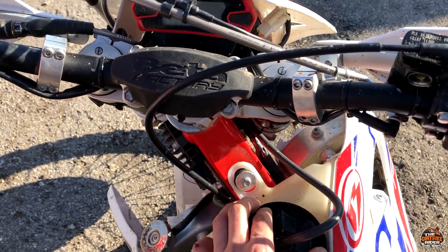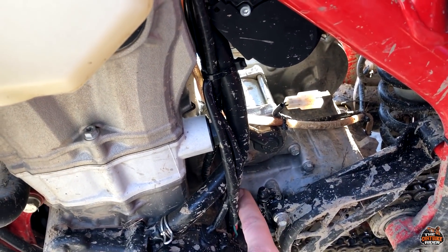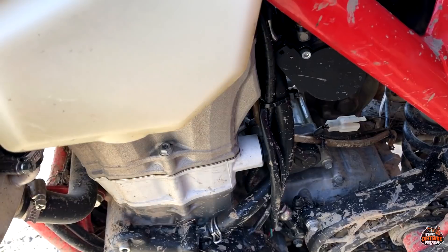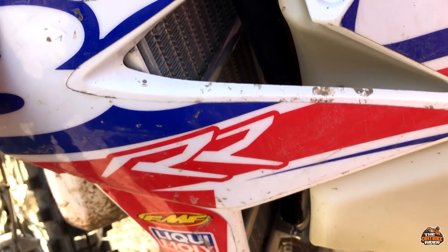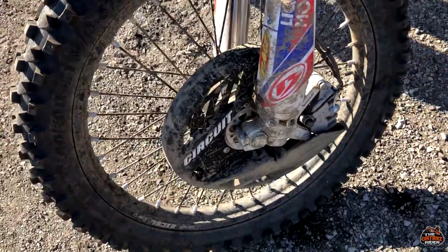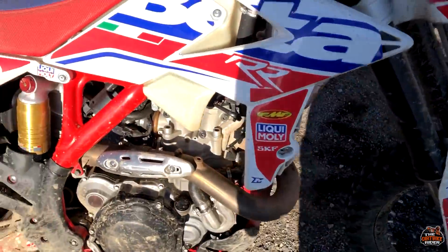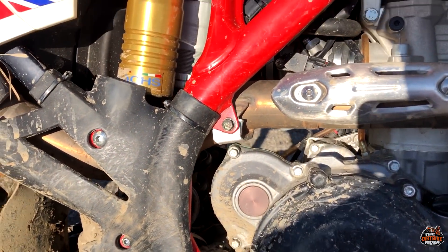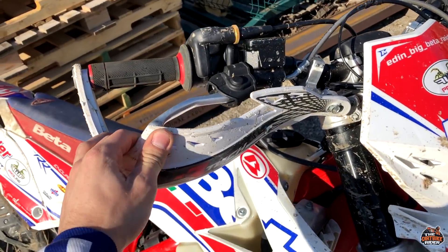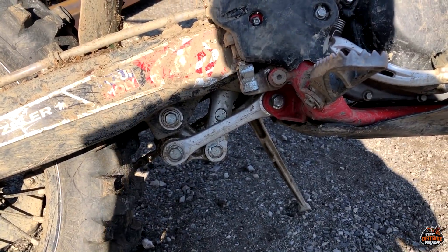It's splitting in your face and on the helmet. He's having a problem with overheating the clutch because the clutch hose is too close to the engine, so the heat goes into the oil causing overheating. He made this protection for the cooling system. He also has the front disc guard, X-grip tires because he wasn't happy with the stock ones, a heat guard, no kickstart. Suspension was really hard and he needed to play with the clickers. He still needs a rear disc guard and linkage protection.